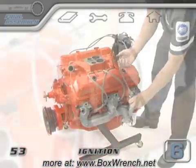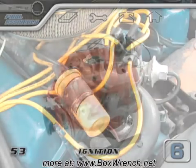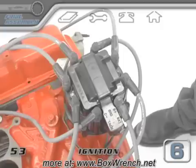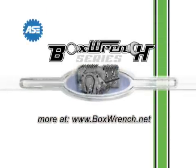This type of distributor has an ignition coil built right into the cap; some engines have separate ignition coils. When you're all set, double-check the order of the wires. Plug wiring mistakes are one of the most common causes of startup problems for new rebuilds. It's really easy to cross a wire or two if you're not paying attention, so take your time and check them over again and make sure that you're sure. When it all checks out, you can organize the wires with some kind of wire separators or something like that.